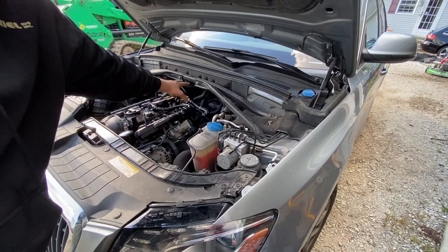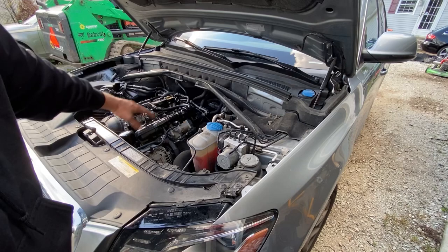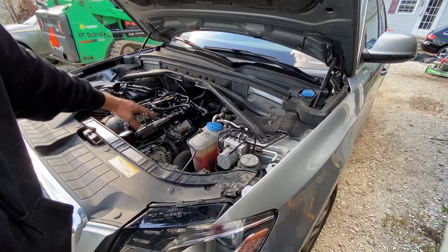I should mention: after you take that off, you're going to lose some fuel pressure. So the first time you start it, it might buck around a little bit, or it might take a while to build the pressure back up. So we're not worried if it's an extended crank again right now.